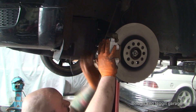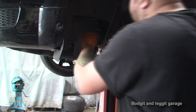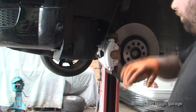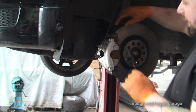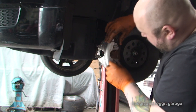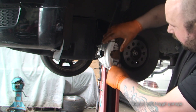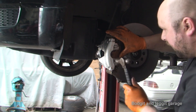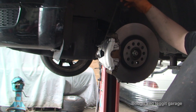Now screw these in — and two. It's just important to put these little dust caps back to stop all the crap getting onto them, because if it does, you can very easily round the heads and make them very difficult to take off. The next thing — these anti-rattle clips can go on really easy or they can be a nightmare. I like to work at one end first to push it in, then come round to the second one, push it in, bend it around at the same time. And it's gone in — just give it a little tap to make sure it's seated.